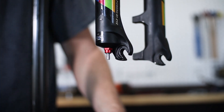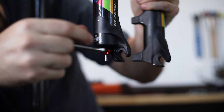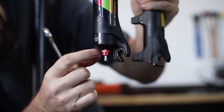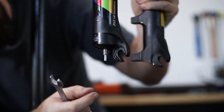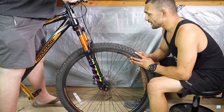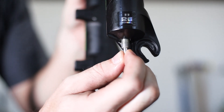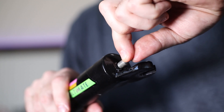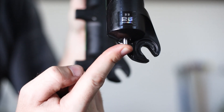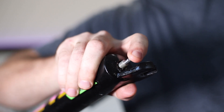Full disclaimer: I did take apart the lowers and I added oil because this fork was bone dry. There was no oil in the lower and the fork did not feel smooth at all — you can especially hear that on WolfTick's video. So this is the damper shaft right here and it does not screw into the lower. Something like this should not be able to be pressed in freely, and you can hear the threads drag against the threads on the lower.